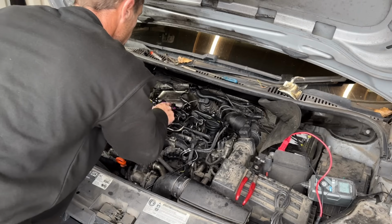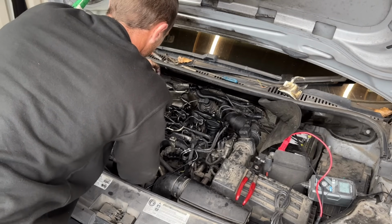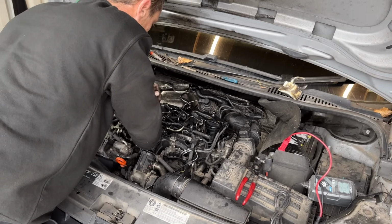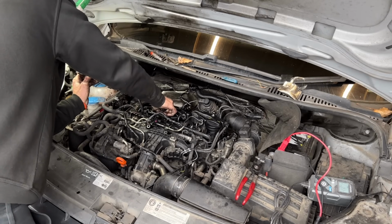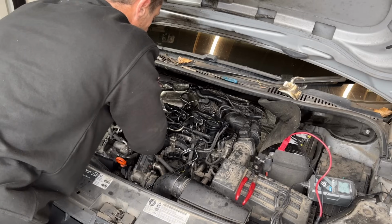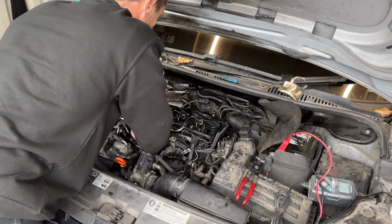If you go to all this trouble and it doesn't fire up the van, just check all these unions are tight, i.e. the fuel lines, because I have also seen that before too. I went to help a buddy out, he'd done his own injector, it wouldn't fire up, so I just checked all the unions and he'd left one loose. Tightened it up, bosh, fired straight up.